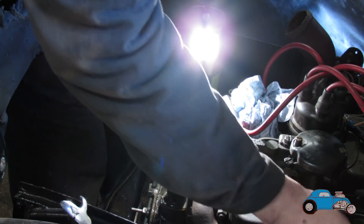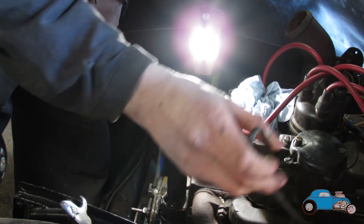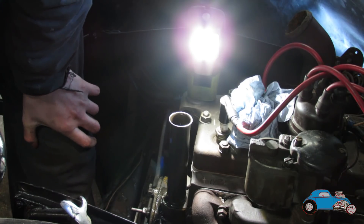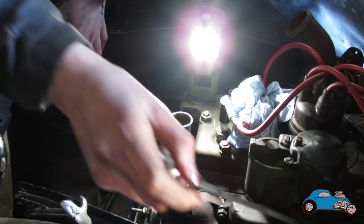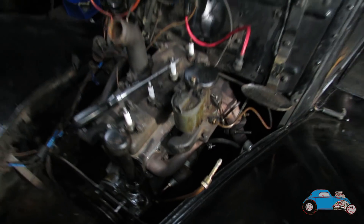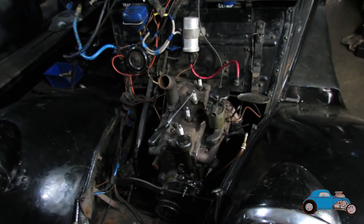Why do I see a drip? It's still showing up as dangerous on the dipstick. It's got a little danger on it. Yeah, we'll give it a chance to run down — danger! We've done a little bit of investigating and it actually turns out there's no fuel getting up to the carb, so we're thinking it's a problem with the pump. We've got another pump, we're going to get that on and hopefully get it to turn over and eventually start up.